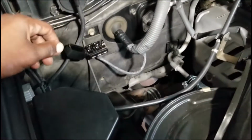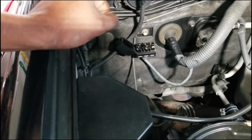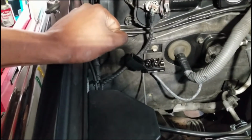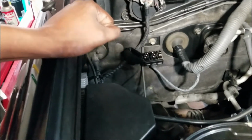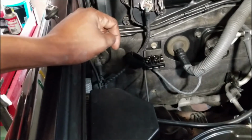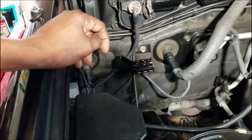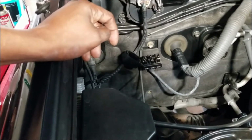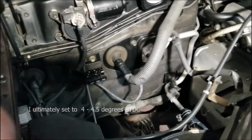And so what we'll do is get those set, start the vehicle, let it warm up to operating temperature. Once it's warmed to operating temperature, connect the timing light, set the timing. The timing is to be set to 3 degrees before top dead center. I do know that people will change the timing and set it to what suits them. But for my purposes, setting the timing to the factory service manual will work just fine for me. So that's going to be the plan. We'll see how long this takes. I'm going to go ahead and get started.